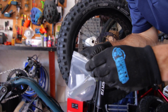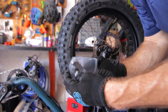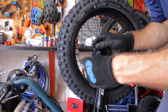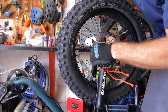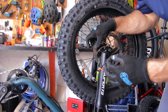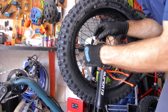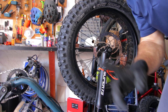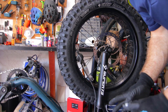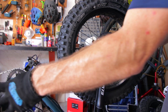This little tool is a disc brake gap regulator — I use these for my mountain biking when I want my brakes to be perfect. It's shaped similar to the rotor, so it can sit right over top of your rotor. When you put the actual brake caliper on, you slide this and it goes in between the pads. The metal is thin enough that your pads sit up against it, helping you position your caliper as you tighten it down so you're not tightening it off-kilter. That is a genius tool. Remember: never hit your brakes while the caliper is disconnected, or you'll have to pry the brake pads apart.